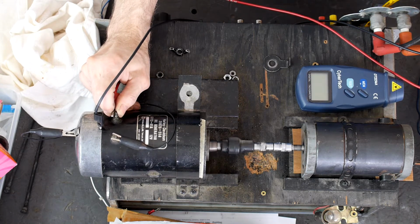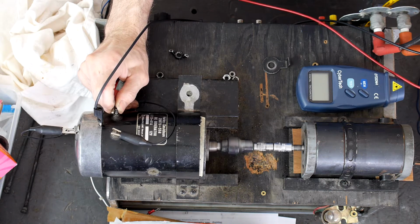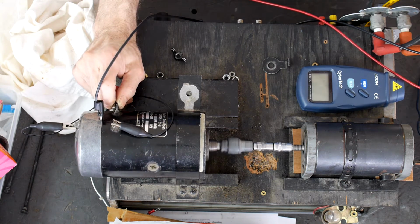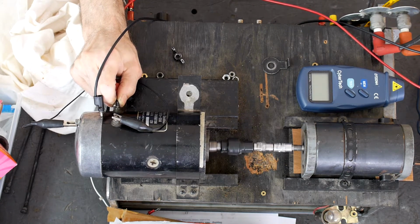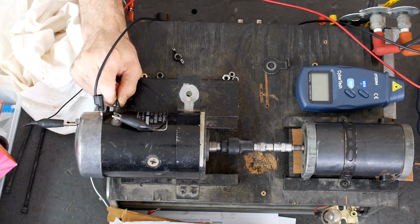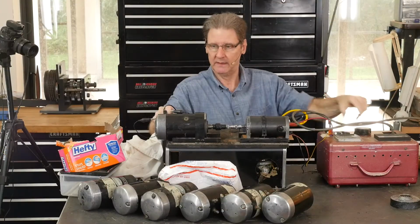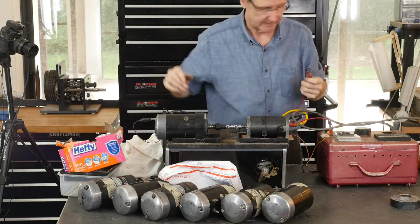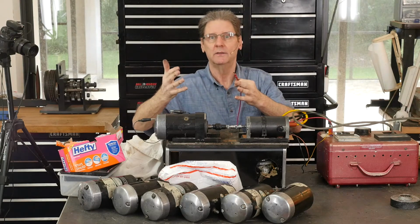It's taking about 10 amps and 30, 35 volts. And you can just see it's hopping. That's either bad commutator segments or melted wires inside the armature. Let's kill it. I can also feel it getting warm because it's taking that much current. It should not take, it's kind of one of those symmetrical things.